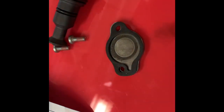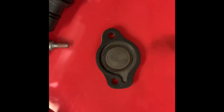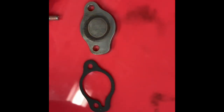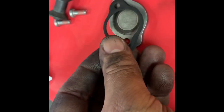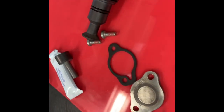When installing it onto the top of the air compressor head, so you're not fumbling around and dropping things, you can use a little bit of gasket shellac compound. It just lets it stick on there, doesn't affect it in any way — so when you're turning this upside down to install it, the gasket and cover are not separate.